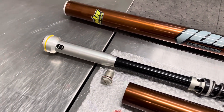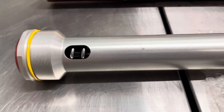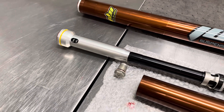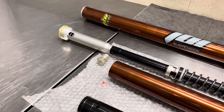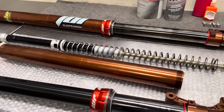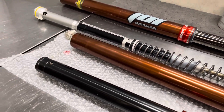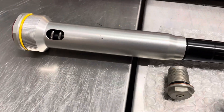These are set up to our JBI suspension motocross spec. Inside, we have our JBI titanium sub-valve installed as well, and we're going to work with some new settings on that. So this is actually a prototype spec — not a spec that's been ridden or gotten feedback on yet. We're excited to get these forks finished up, work with one of our test riders, and get feedback on how these work and what changes we need to make to fully take advantage of the JBI titanium sub-valve installed inside this cartridge.